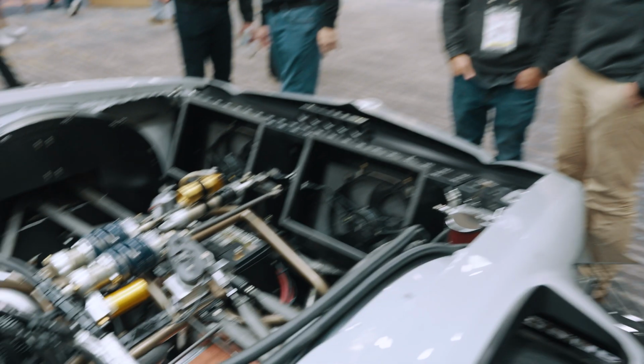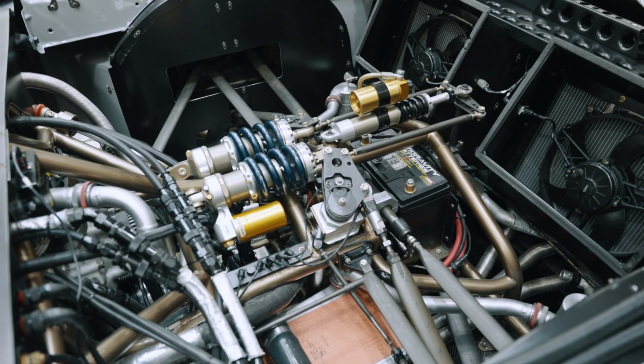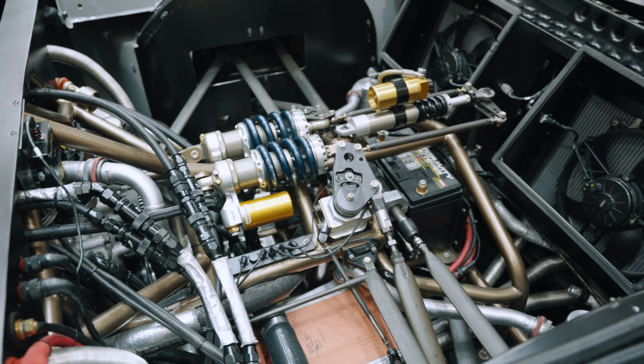So my dad basically lengthened the spring gap so then it wouldn't come into play. I went to 161, stable as can be. I could take my hands off the wheel if I wanted, and it was great. So yeah, it's a super, super critical tuning device.